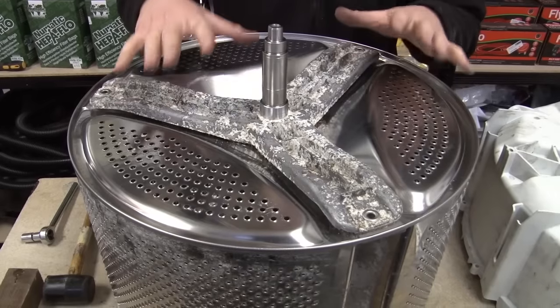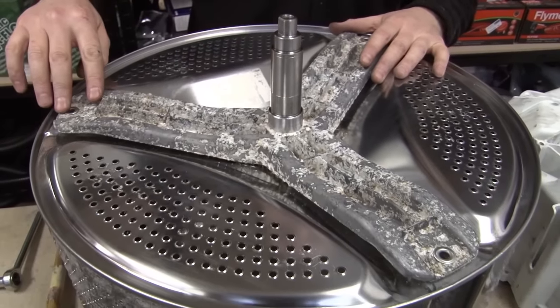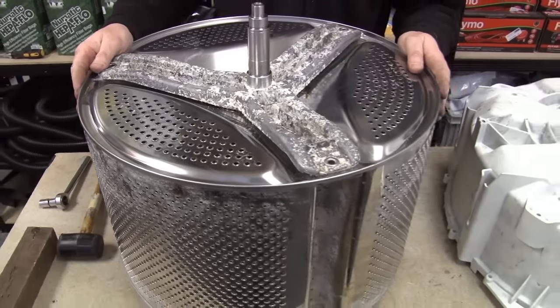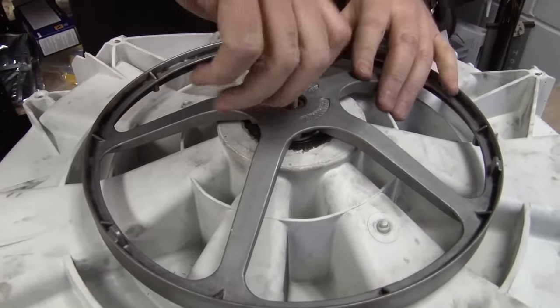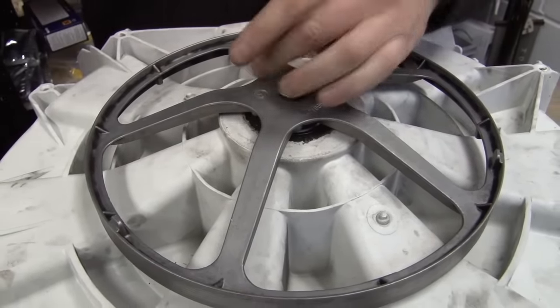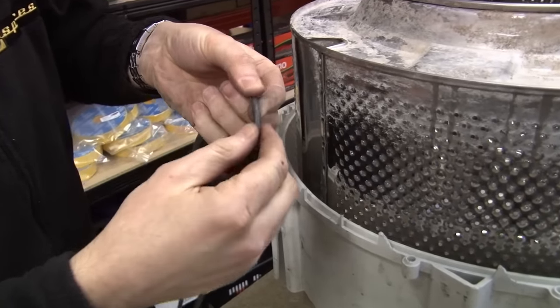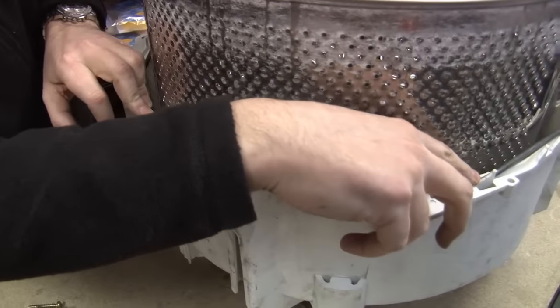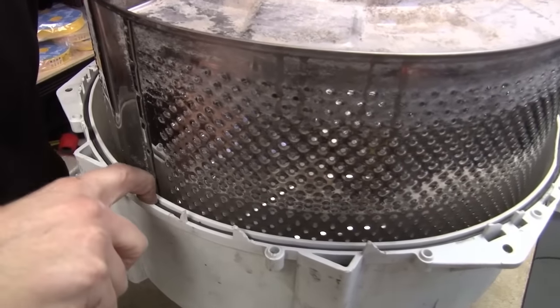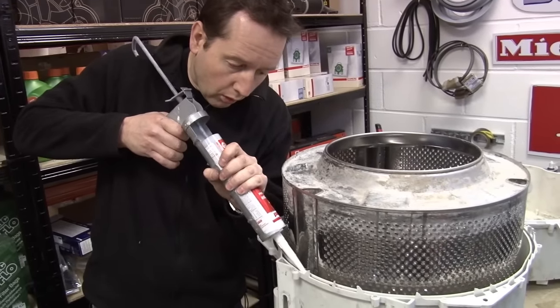Let's put the tub back together. I've cleaned up the top of the drum and the spindle — it's really important that the spindle is clean and that there's no damage. If it is damaged then on some machines you can replace the spider, but on this one it's actually riveted to the drum so you'd need to replace the whole drum. Drop the pulley back on and tighten that up. Before we put the tub back together, we're going to need to put in a brand new seal. You need to find the join in the seal — it's very often marked — and put that at the top of the tub. Just feed it into the groove all the way round. The seal's in place and pushed down to the bottom of the groove, and then I'm going to run a bead of silicone sealant all the way round.